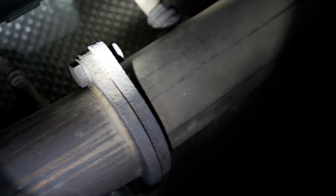Now there are two more bolts going from the downpipe to my test pipe — or if you're stock, from the downpipe to your stock cat. Crawl up under here, they are both right there and really easy to get to — both 14 millimeters. I also have an O2 sensor up there, so that's a 22-millimeter wrench to pull that big boy out, and then your downpipe should come right on out.